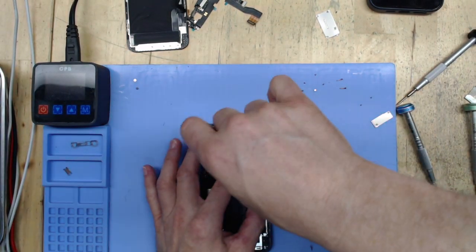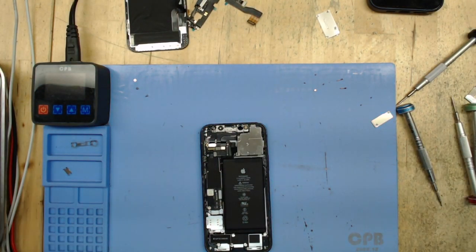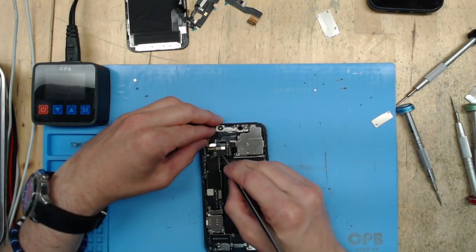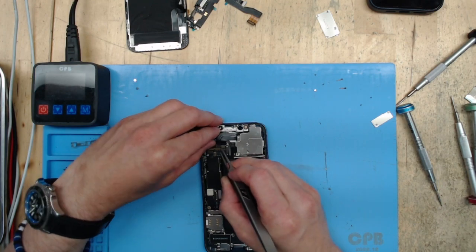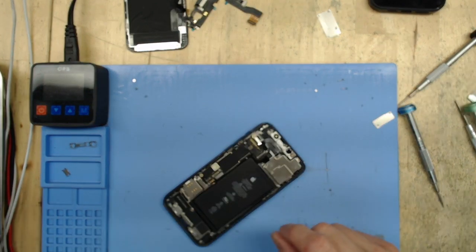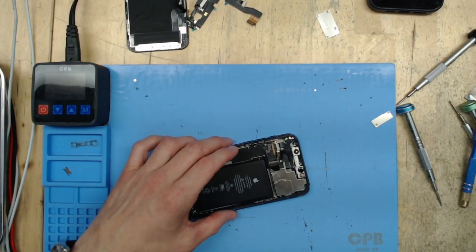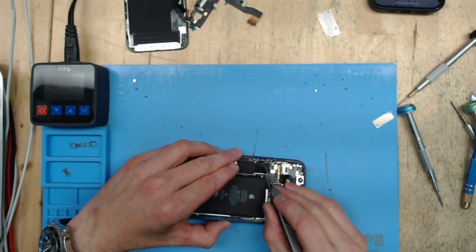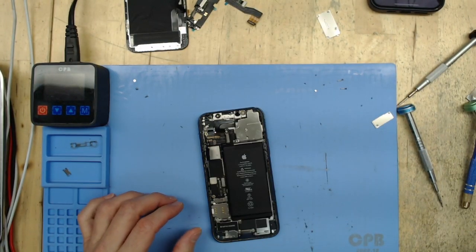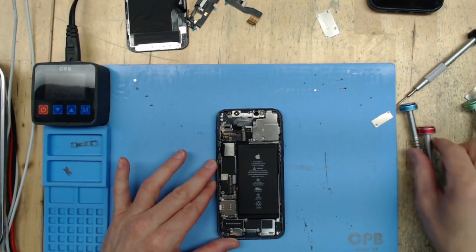Go ahead and get underneath this camera. I'd recommend you take the camera module out if you're not confident you won't damage it, because you can easily damage the flex by bending it too much. I'm confident I won't do that. Here I've taken the razor — I'm going to slice this sticker so I can pull the power button up. It's connected by a big cable there. That big silver chip you see underneath there — that's the NAND, that's the hard drive.